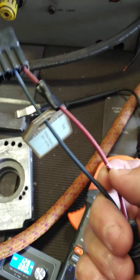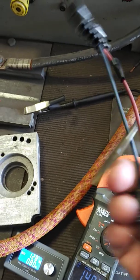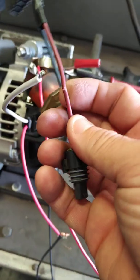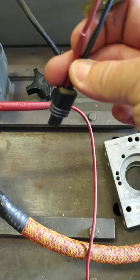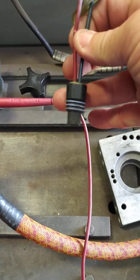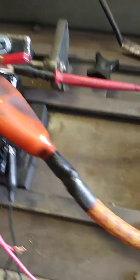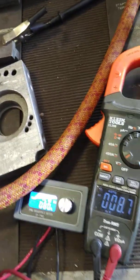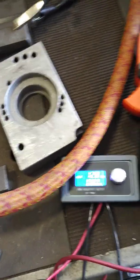You're going to tap in — meaning you're just going to splice into it and run an extra 14-gauge wire from here to connect onto here. Your factory harness will not be plugged in, but it's still in the vehicle. You still have your OEM plug; you're just going to tap in from where we tell you on the instruction sheet. Once you've got all that connected and follow the instructions, you're all set up.